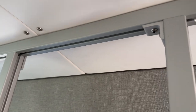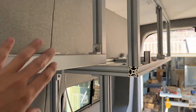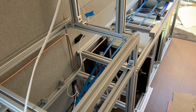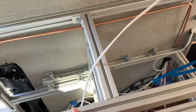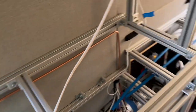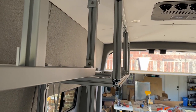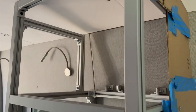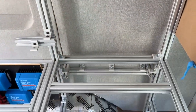Our sink is going to be here. We didn't want our cabinetry to come all the way out to the edge of our galley — the reason being that if you're standing here you don't want to be facing the cabinet, you want to have a little bit of clearance so you don't hit your head and you have a little bit of visibility down to the dishes. That's why we have this offset for the deeper cabinets above the bed versus the shallower cabinets here above the kitchen galley. Over here is where our refrigerator is going to be, and similarly to the other side, we use angle brackets to attach both at the base and up toward the top.